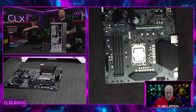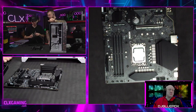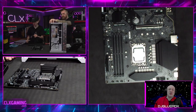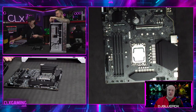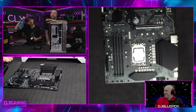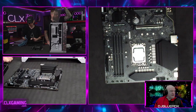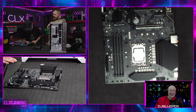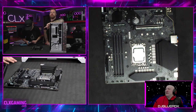A friend of mine had to take his PC into Best Buy because he couldn't figure out why it wouldn't work — it turned out he'd only secured one of the screws on his AIO. That'll definitely cause issues; you'll usually see overheating as a result. You want to make sure all those screws are down tight enough.